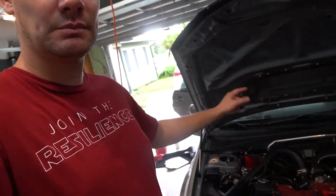As of right now, the car is good. It's up and running. I can go drive it 30, 40 miles an hour, but there's still a lot I got to do. This is a whole new standalone ECU, so this car doesn't know what the hell is going on. Luckily, this is a plug-and-play model, so the dangerous things are done — the timing setup, the triggers for the camshafts and all that stuff. All those basic things were done. I just had to configure it to the way my car is.